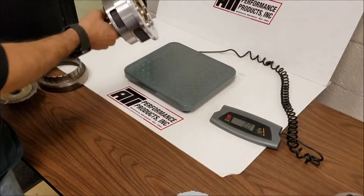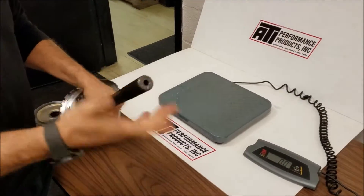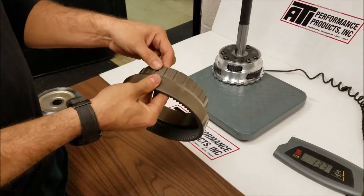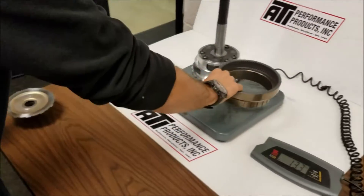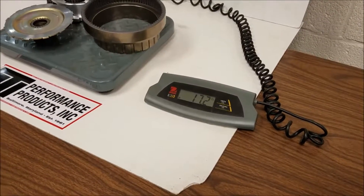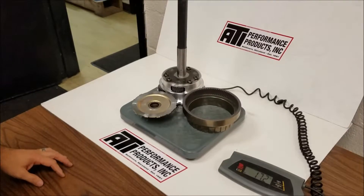This is the aluminum carrier, and these are coated gears — no weight change there obviously — and then a little bit of a gun drill in an OEM shaft; can't get too big in an OEM shaft. We also have this cut specifically for the amount of reverse clutches, which in this case is four instead of five, which is standard. It's 17.2 pounds from 20 and a half, and that's direct rotating weight, accelerated weight, and you carry that with you the whole way down the track.